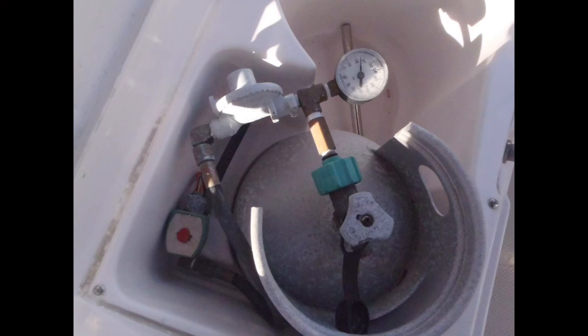That's the purpose of the gauge in your propane system — it's not there to tell you how much fuel you have, although it will do that. The main purpose of that gauge is to allow you to conduct a leak down test. Leak down tests are a simple, easy way to check the health of your LPG system and should be done on a regular basis. To conduct a leak down test, turn on the tank valve and energize the remote solenoid switch if your LPG system has one installed. This pressurizes the system from the tank to the stove. Note the pressure gauge reading and then close the tank valve, leaving the solenoid switch open or in the on position. The gauge reading should remain constant for at least three minutes. If the pressure drops, then you have a leak or leaks which must be found and corrected prior to using the system.